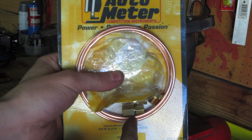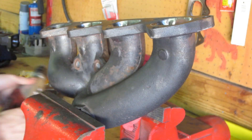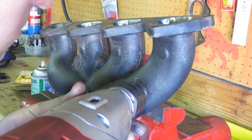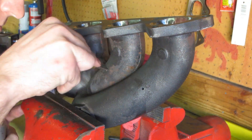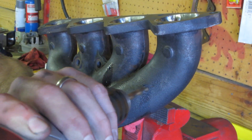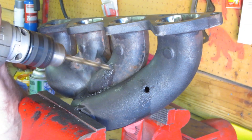We're right back at it — time to install the eighth inch copper tubing and get this thing back together. But first, let's drill some holes in a perfectly good manifold. I'm currently drilling not one but two holes in an FP manifold. The plan: run an EGT gauge in one hole and get a back pressure reading from the other. Both could be done from a single hole, since pressure doesn't frequently change unless there's a change in restriction or flow.